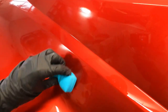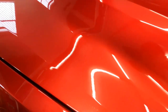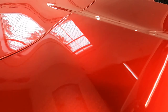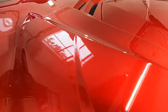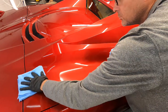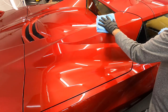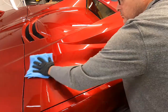You can start to wipe it off as soon as you have it applied, but if a customer walks in or you get an important phone call, it really doesn't matter how long — you can easily wipe it off. Wiping it off is easy; just have two microfiber towels within arm's reach. You'll see a rainbow effect as the coating starts to bond with the surface — that's when it's time to wipe off the transfer solution. As soon as it hits the surface, the coating is making contact and starting to bond.